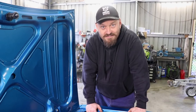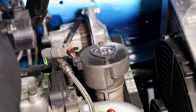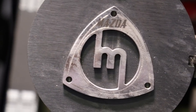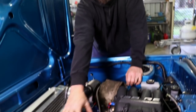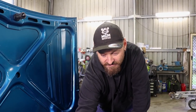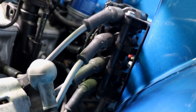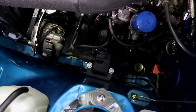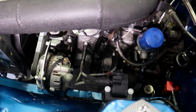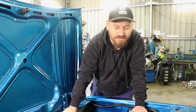The engine's run by a Haltech Elite 2000 ECU. It's using a series 4 crank angle sensor, which is a little reluctor unit. Normally this engine doesn't have a distributor drive at all, but this has been converted back to an older style front because the engine actually mounts off the front cover plate. So it's using that dizzy, which works fine — you just have to set things up properly in the ECU and it'll pick up good engine position signals. It's using LS1 coils, just one bank of an LS1. Good coils, heaps of grunt. These things have pretty significant spark needs so you need some decent coils, and those ones are cheap and work really well.